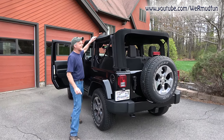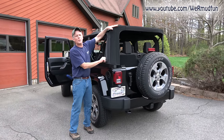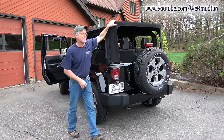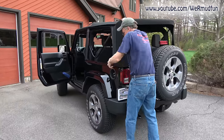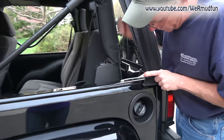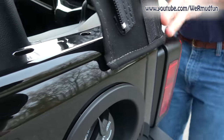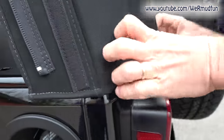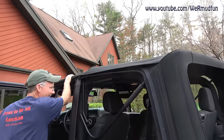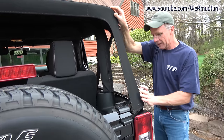One more piece of nomenclature: the side bow. These panels here are called the sail panels. We need to pull down on the three bow to get them up into the retention area — just pull down. You can see how it's sliding up underneath the body retainer. There you go — now it looks a lot better, nice and taut. Get the other side: pull it down and set the retainer up underneath. Now it already looks like a soft top.